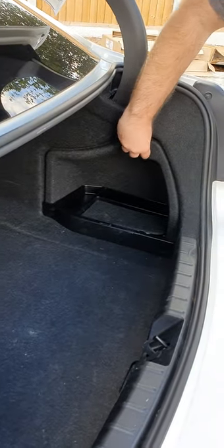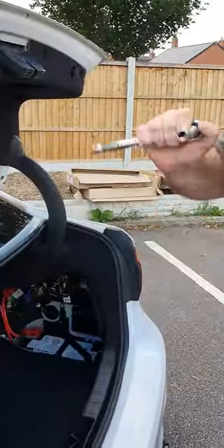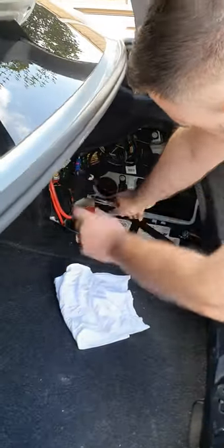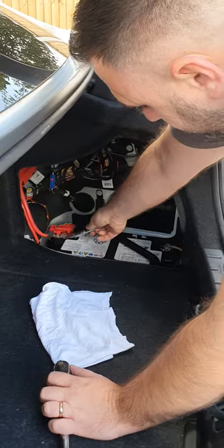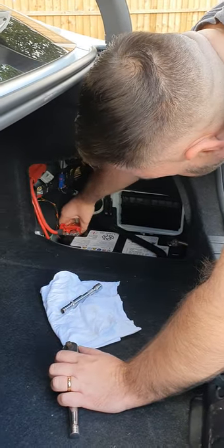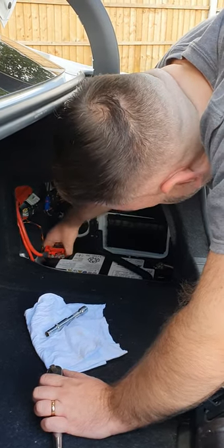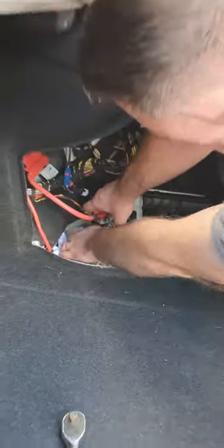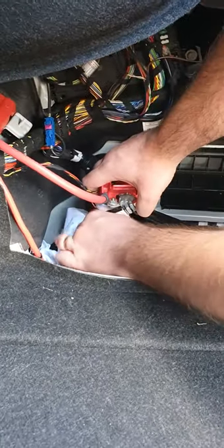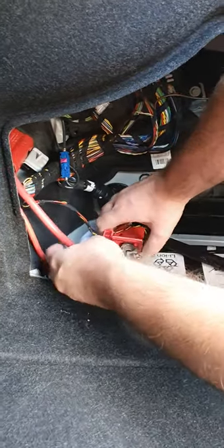Normally on the six-cylinder models, that's where the battery's located. Twist that to the side and you've got the big beefy battery in there. Get your 10mm out — lefty loosey! You disconnect your live, being careful of your wires, all your loom, everything in there. You want to disconnect the nut so that it's free-moving. If it's never moved before it might be a little bit stiff to get off. There's a lot attached to it, so you may be better off getting rid of the negative instead.